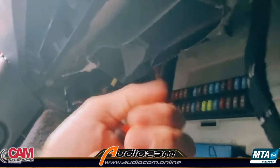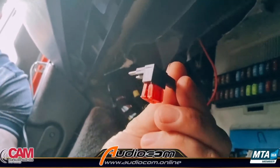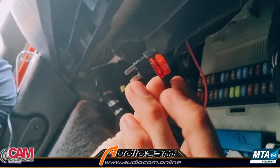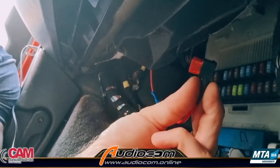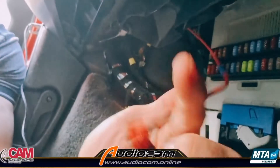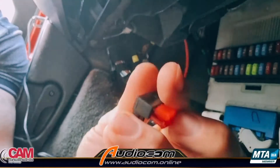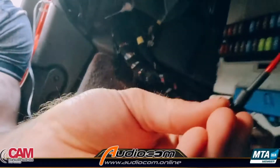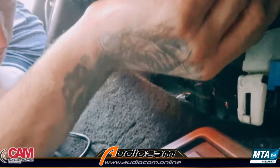The way we tapped into that is with a very smart little adapter called a fuse tap. You pull out the original fuse, and two new fuses go into this little fuse tap so the circuit is still fused, then this goes back into that same fuse position. That gives us a switched accessories feed output that goes up to the head unit, while still retaining the original 10 amp fuse on that circuit as originally intended by the manufacturer. So we clip that in — there we go, that's all in position. It doesn't interfere with the factory fuses at all — very nice and neat, and we haven't had to chop into the vehicle and modify it in any way that would be detrimental to the vehicle's integrity.